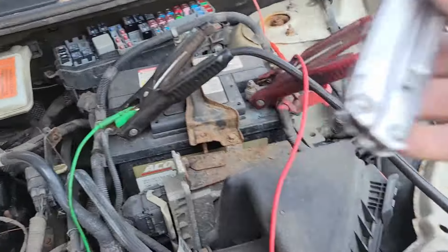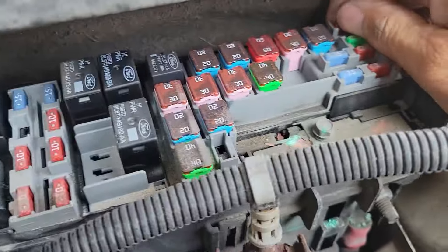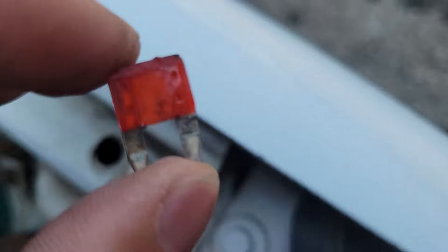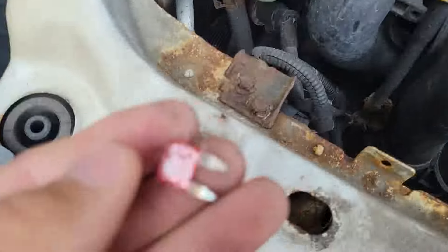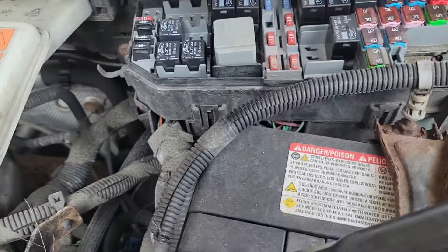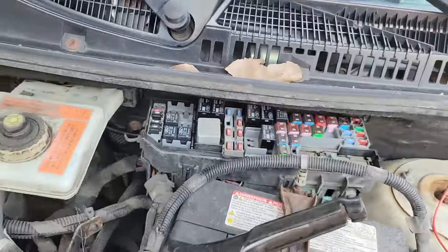It's hard to get my hands in here — there's not much room on these vehicles. Let me get my pliers. That is a corroded fuse. Let me get some light behind it so you can see — it's got corrosion on it. I'm going to grab a replacement fuse. Okay, we've got a replacement fuse. Listen closely as I plug this in — we'll see if we get some relay click. Yes! We did — we've got ourselves communication back.